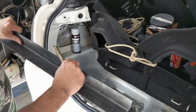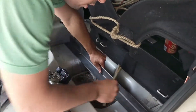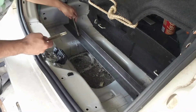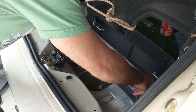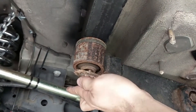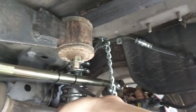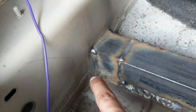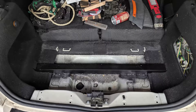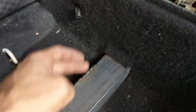Basically never used weld-through primer before so it's a good time to test it out. I've got a jack holding up the differential right now and now that this is all dry we'll go ahead and drop through our bolts. Now we can bolt it up from the underside. The seam sealer really messed up that corner right there but that's not the area we're really worried about. Up here we got a really nice weld, really nice penetration and basically everything worked out really well. We'll later add in some gussets right here and that'll help tie a little bit more into the frame.